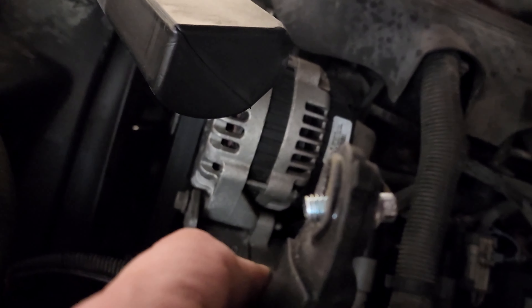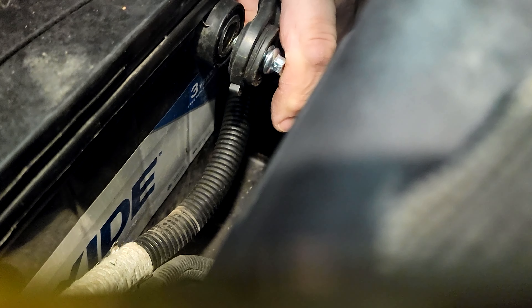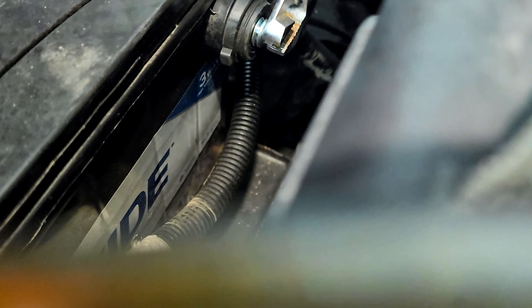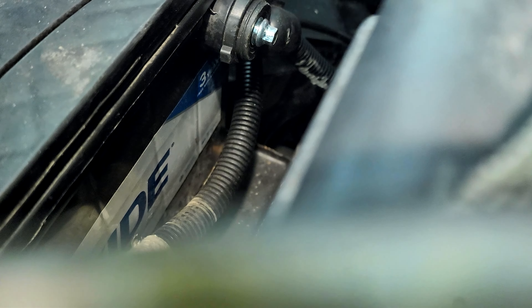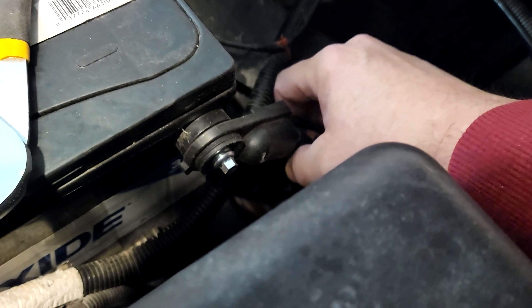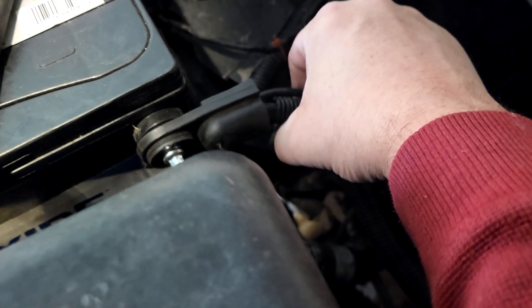You can see I've got it on that side and on that side, and I have enough bolt sticking out to now connect it to the terminal. It's going to spark when you first touch the battery — that's normal, because you're making contact. It's not going to hurt your fingers because the spark is between the bolt and the battery housing. Continue tightening and be aware of where the rest of your harness is when you get tighter, because that's where it's going to stay. You want to work it so it's not touching anything else. Observe where it was when it was tight before you started taking it out.